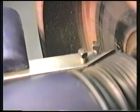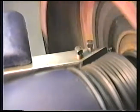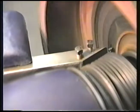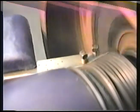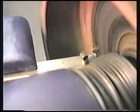So now what we'll do is start the lathe. We'll find the high point, which is the unused friction surface here, or the part not worn away as much. Okay, that's top, so we'll set the little graduated hand scale at zero like we did on the small one. We'll walk this in all the way. Take a depth of cut as necessary, like we spoke about before. Lock up our spindle so it won't travel on us.